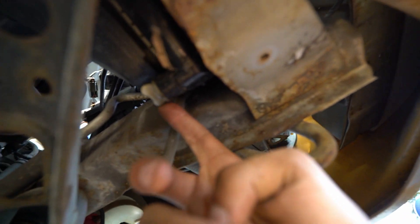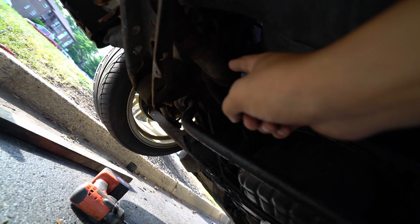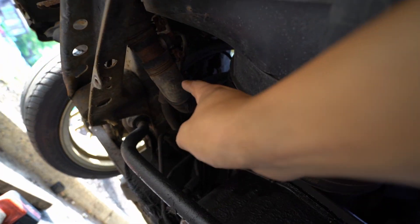All right, finally got the splash shield off. Come over here — you find the radiator right over here. Pull up over here and you find this little valve right here. If you don't have that valve then you're gonna have to just let go of the lower rad hose, which is right over there, and that's gonna be very messy.